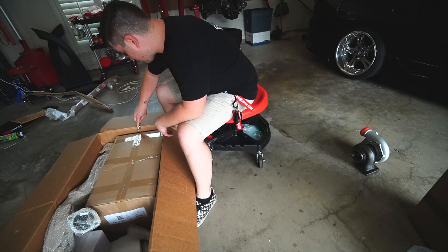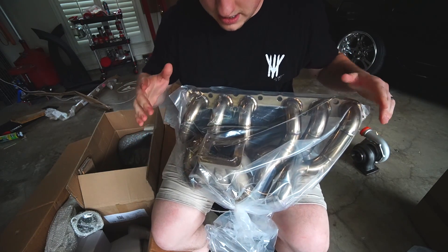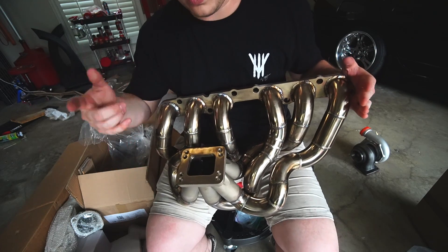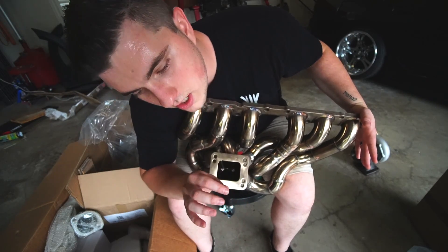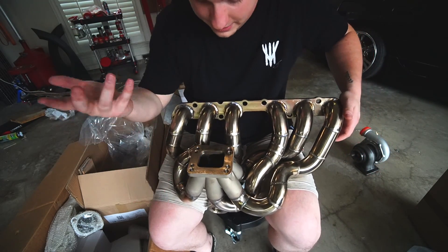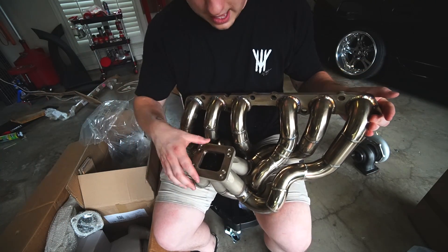I'm going to guess this is the exhaust manifold — yes sir. Here's one reason I really wanted to get the CX Racing kit: it's actually dual drilled for both a T3 and a T4. This exhaust manifold is inexpensive, but on the IS300s there are some kits out there that don't allow you to keep the ABS module. We're going to keep that — I don't want to have to delete it again like I did on the Supra. Here is my T3/T4 exhaust manifold. It's a lot lower sitting than my Supra one, so it looks like it's going to fit pretty well and be out of the way.